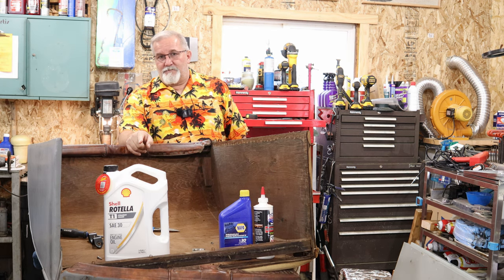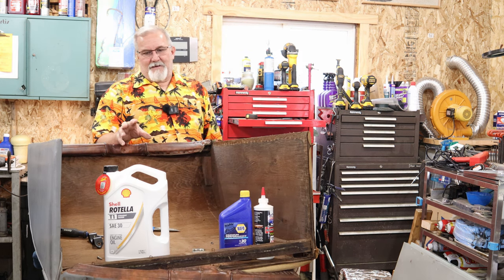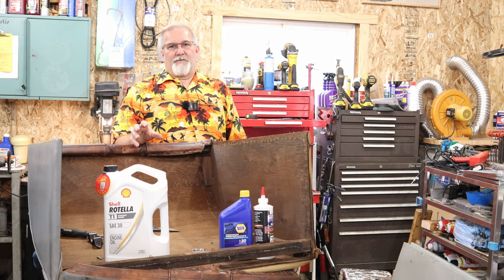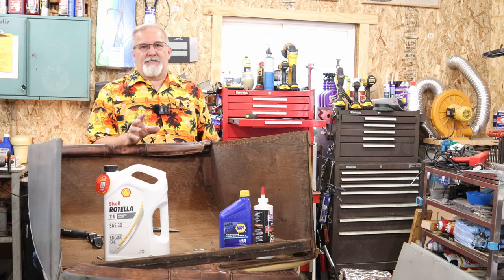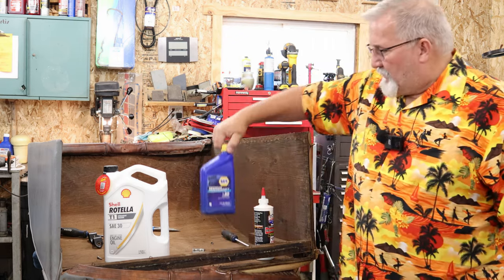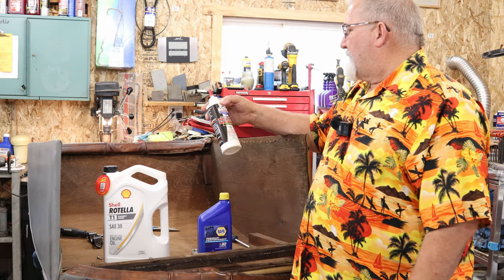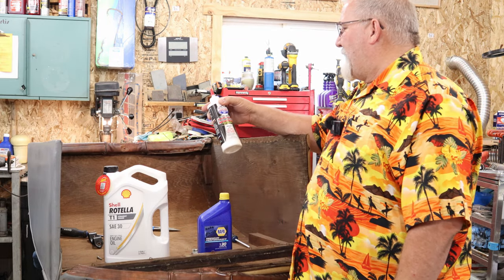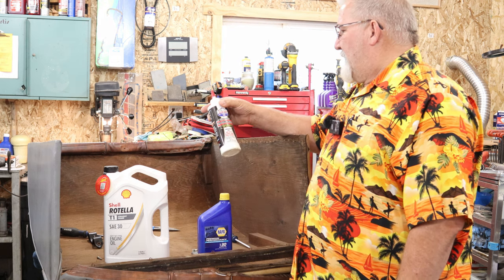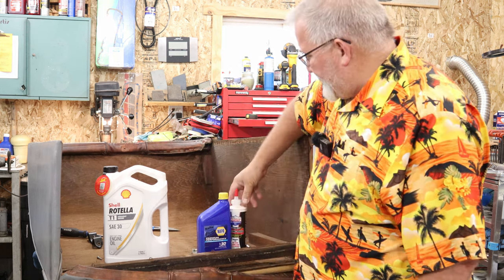And I thought, awesome. And the other thing I got to do a little more research on, but this Rotella diesel oil has a lot of zinc in it. And zinc is what you need on these old engines with the lifters and the tappets and the cams and the whole nine yards, right? Well, you can run just a regular newer oil, and then you can put this Racing ZDDP TB Zinc Plus.